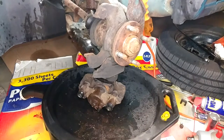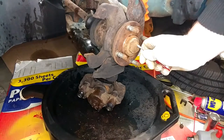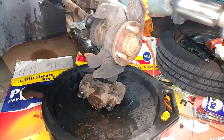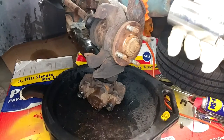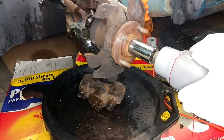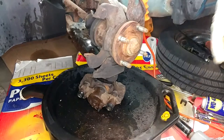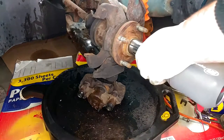For the core, I just put some grease over it — nobody ever asked. I'm kind of excited about the core charges that might be coming back to me that I'd forgotten about years ago. I know AutoZone will give them back years after the fact. This axle nut is 32 millimeter, which is also the exact same as one and a quarter inch. I've got it in neutral right now — I may end up having to put the wheel back on and put it back on the ground to break this loose. I'll try it in first gear.